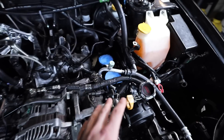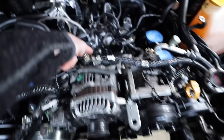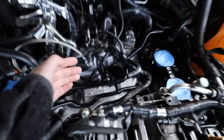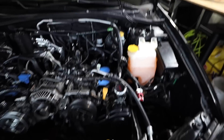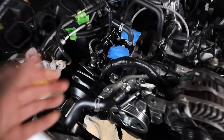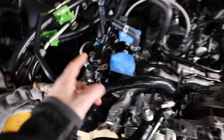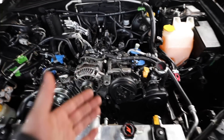What I'm going to start with is getting the fuel rails on the front closest side — those are going to feed into a T fitting right up here. Once we get that T fitting done, we'll mount up the fuel pressure regulator so we can do line length on everything else. But for now we can start easy, get these first two fittings done, and I can walk you through how to make this fuel line.